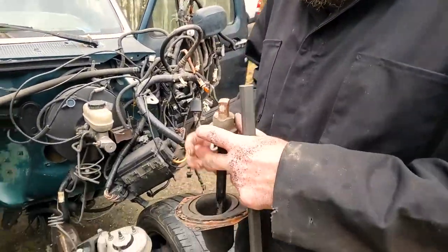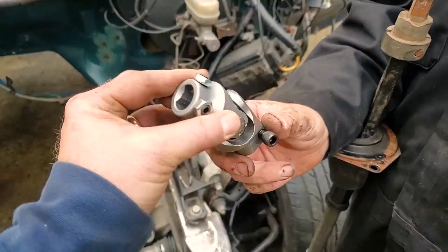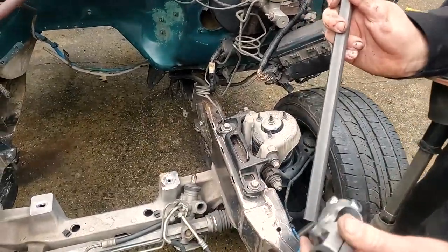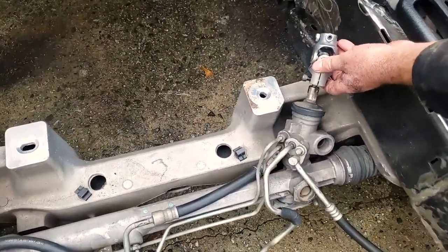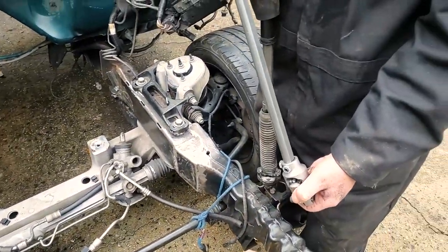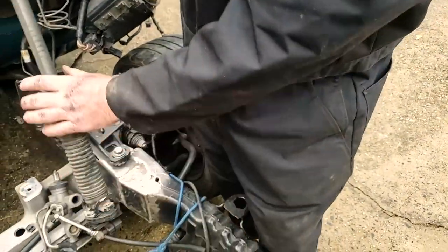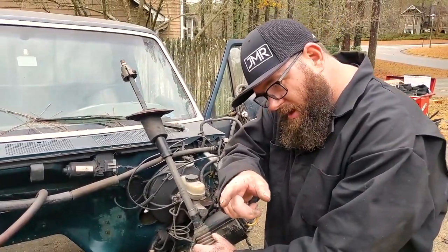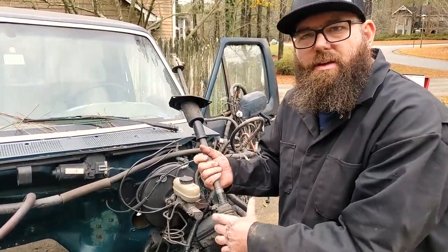We bought this right here — the part number will be in the description so you guys can get it too. This part is the sleeve that is literally shaped to match the Crown Vic knuckle — it's perfect. So it goes right here, and then this piece is shaped for your steering stock which goes right here. What you do is put this piece in, figure out your length, cut it to the length you need, slide that up in there, sleeve it into this, and weld a bead all the way around. That's it — piece of cake.